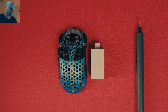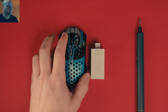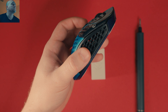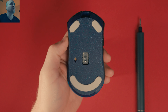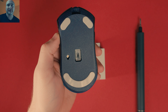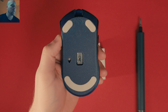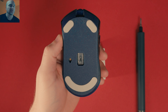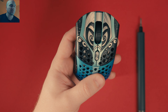The second that I hooked it up, everything fit flawlessly and I was honestly just really blown away that he did such an amazing job at creating this base. So what it is, as you can see here, it's the base of the mouse. You basically use everything for the top shell and then you just take the bottom out. You obviously need to purchase the Razer Viper V2 Pro and disassemble that, which is incredibly easy. The whole process was actually pretty simple. I am very tech savvy - I customize lots of my mice, I swap switches, encoders, all kinds of stuff.